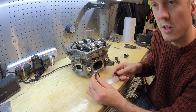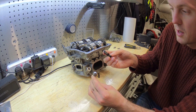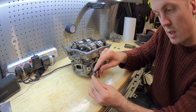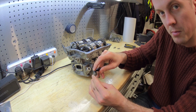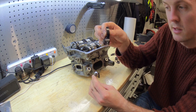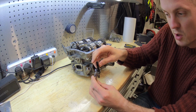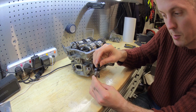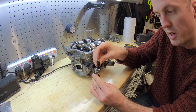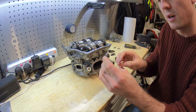Conventionally in a conventional engine using valve springs, there is normally a spring that sits under this collar and pulls the valve back out, and you would have something similar to this — a rocker which sits on top and gets pushed down by the camshaft to push that valve open and then spring back up. In the case of Desmo — and this is the big difference — there isn't a spring under here. Instead there's this sort of lever hook, the closing rocker arm, which hooks under the collar and gets pushed by a second cam on the camshaft to lift the valve. So it's actually positive closure — it's not based on a spring, it's positive engagement from this closing arm. And that is where the complexity of this drivetrain comes from.